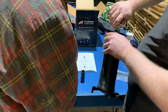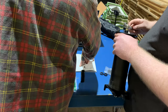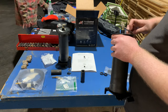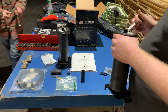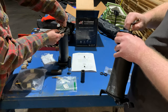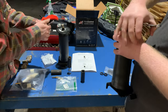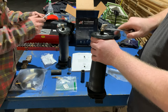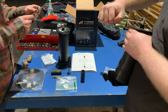It's a swivel, so you gotta use this. What does it say? Finger tight plus 1.5. I would tighten the hex by hand first. Yeah, until it wouldn't move. And then, of course, now it's loose, so I gotta re-hand tighten it. 1.5. Wow. That's one. That's not a half. It's been stretched. And a half.